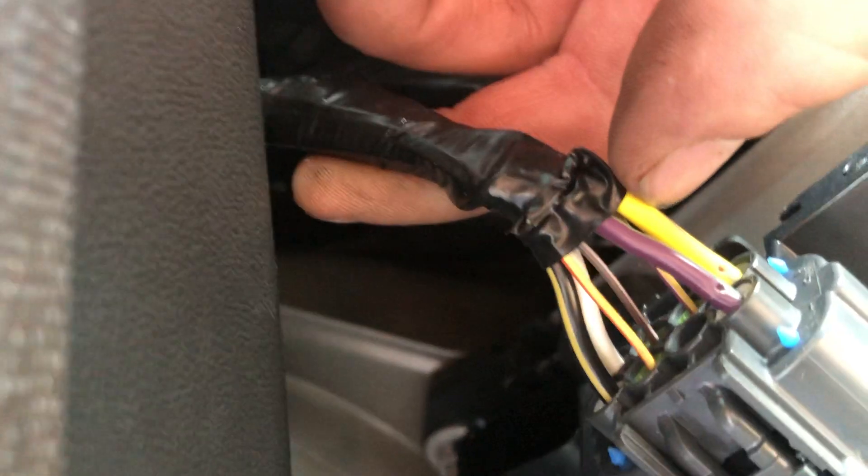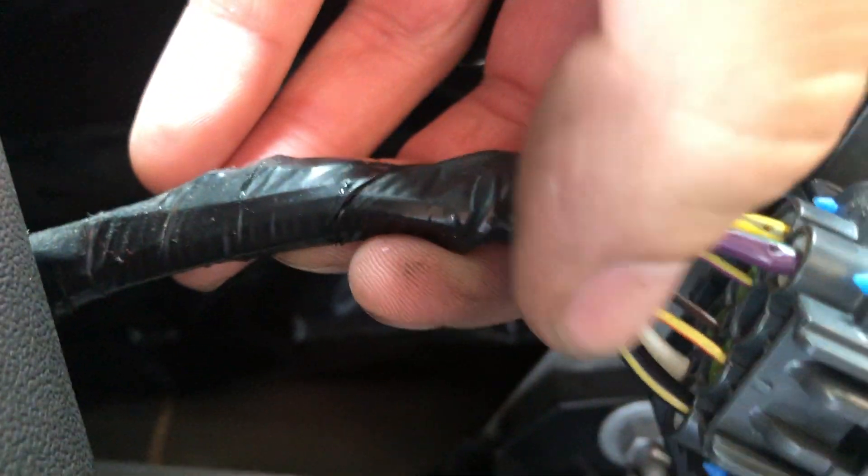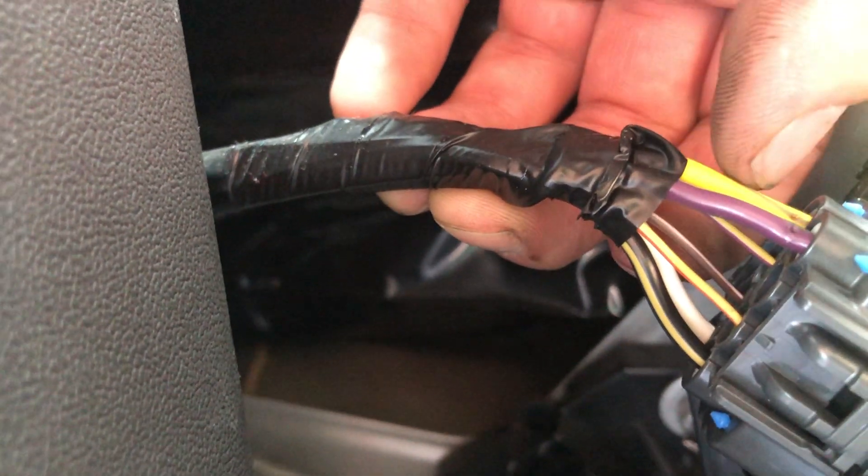On the other side, you're going to want to check power and ground coming out. Yellow and gray right here should have power out while cranking, and white with a dark tracer wire right here on the back side should have ground out — both of those while cranking.